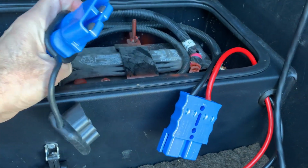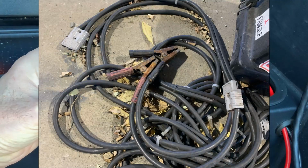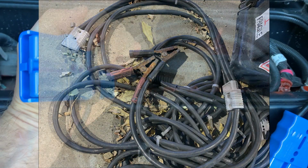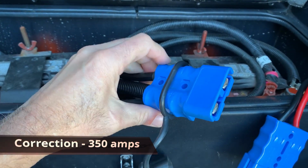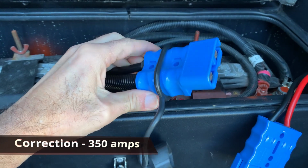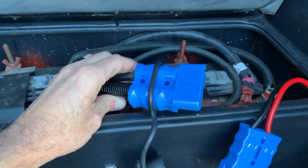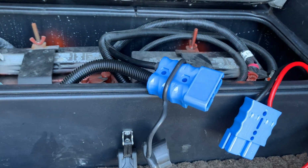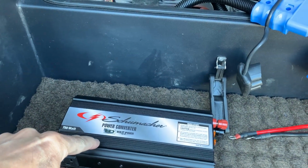A friend of mine suggested a plug that they use for batteries on the back of fork trucks. So this plug here is rated for, I think, 180 amps, DC amps. So this is a huge, beefy plug. Now I'll put a link in the description below on where to get this. But this is basically what you've got to have when you have a possible 62.5 DC amps coming from the battery to the power converter.